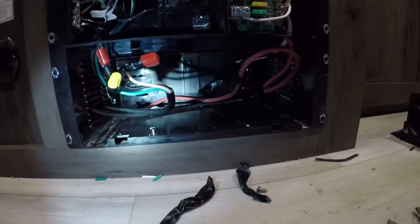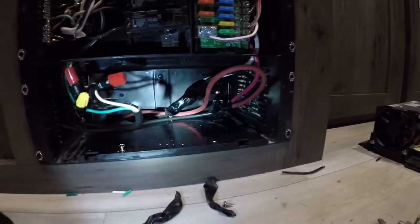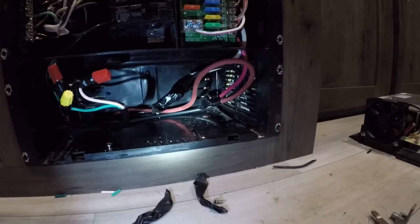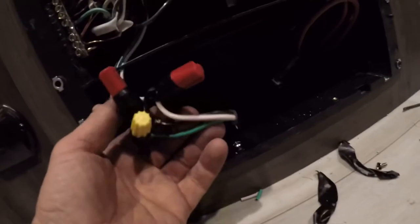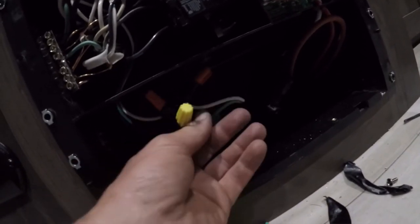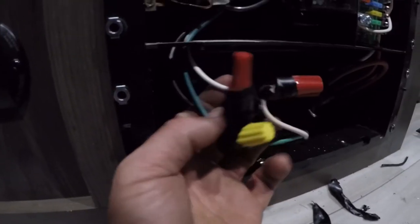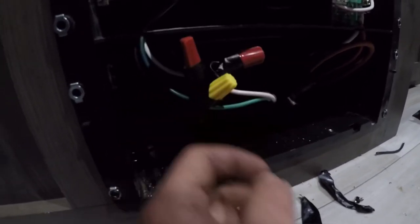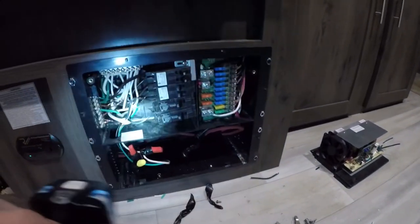We got our panel back in. Here's how I chose to do the wires — I got some lugs on the negative and positive there, which branched through, one over to the converter. Here I just took my wire nuts and electrical taped them up. A lot of vibration so you definitely don't want them coming off and shorting out — it's just good practice. And that sloppiness of these tails is what an old electrician taught me, what we call a courtesy tail.